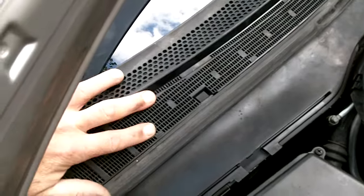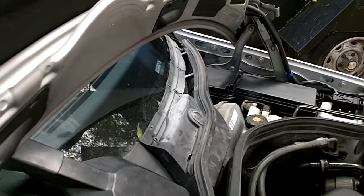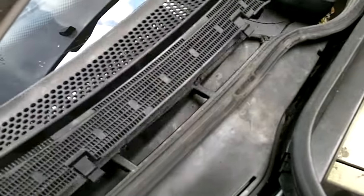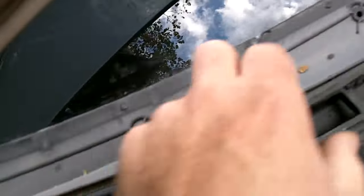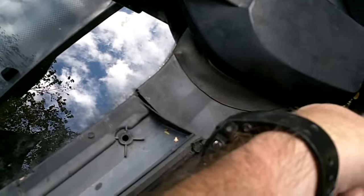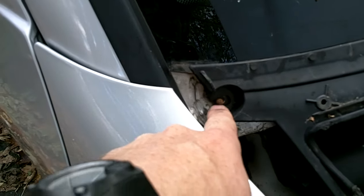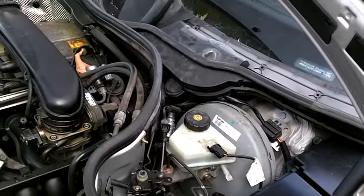The first thing you've got is the two leaf covers, one on each side of the wiper. All these do is — there are little tabs here — push them in and pull straight up toward the windshield. Pull it out and there'll be a bunch of Phillips screws: there are five in total, plus a 10 millimeter plastic nut on the end. Take those five Phillips screws out on each side, and the 10 millimeter plastic-headed nut on each side.